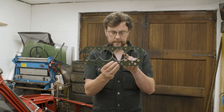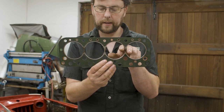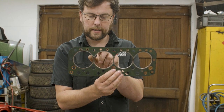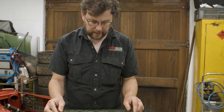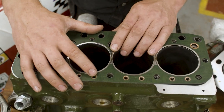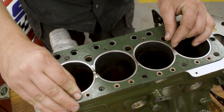One of the things I want you to notice is the misshapenness of the gasket, specifically where cylinders 2 and 3 and 1 and 2 would be — the gasket looks pretty good between the centre cylinders. You can see a misshapen form to the gasket. If we put the gasket on the engine block we also start to notice something else — there is huge overlap on the bore; all the way around, the firing ring sits over the edge of the bore.